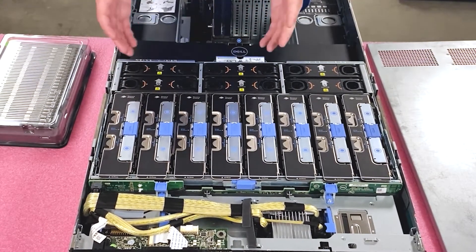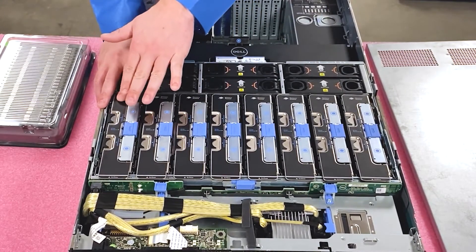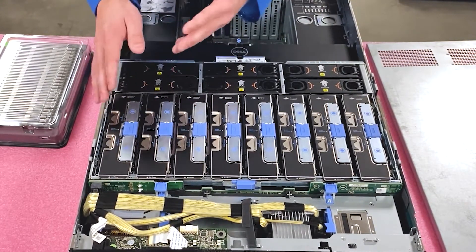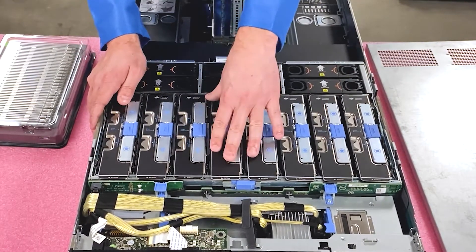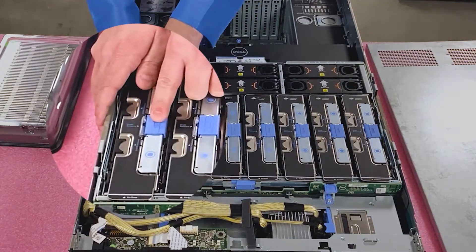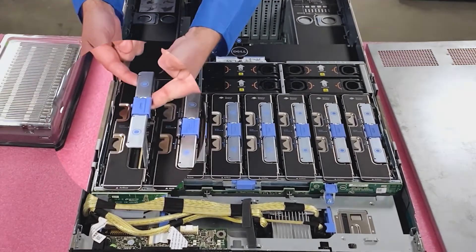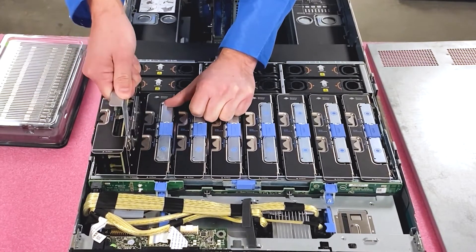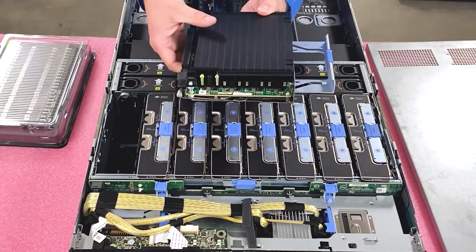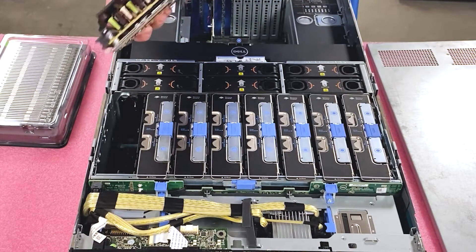This part can be a little bit difficult, but it's not too hard. You just need to make sure that you're pushing the right buttons because it can get a little stuck and you have to apply a little bit more force than you'd like. So first things first, you're going to take the blue tab and slide it forward — when you do that, this is going to pop out. You're going to lift this up. Then when it comes out, you'll see the memory riser just slides in and out really easily.